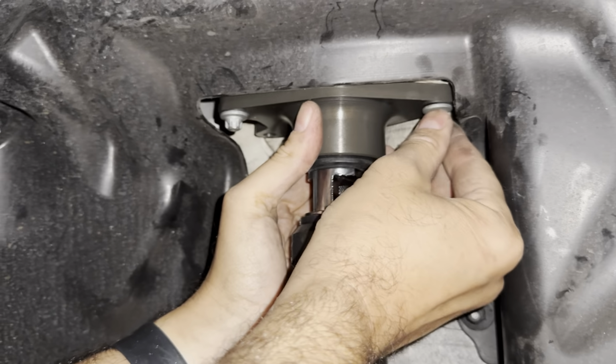So we'll drop it down, and we're about 1.5 centimeters off. So I think if we just move the shock maybe by 1 centimeter, because obviously it's further in, so it changes. I'm not gonna do the geometry to work that calculation, but we'll try a centimeter up, and that should give us a pretty close indication. So we'll get the calipers and we'll measure off here, and we'll wind up a centimeter. We're still okay in the jack stand. Yep, it didn't move.